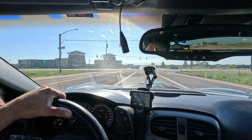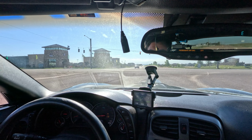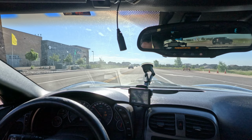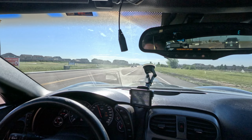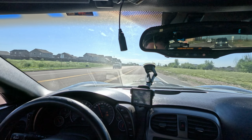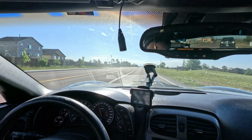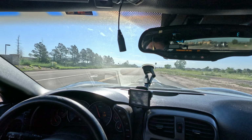You know, when you're doing a pull, I need to go drive around and do some drivability tuning, but it definitely feels better than it did before. Smoother, that is. I did a lot of work on smoothing the table up, and the fueling's the same. I ain't changed the fueling any. It's still 12.5 during the pull on E85. I may lean it up a little bit and see if it does anything differently. I doubt it does, but it might.